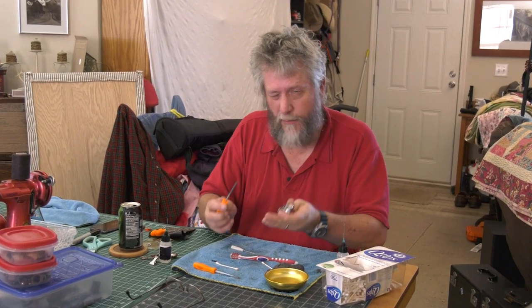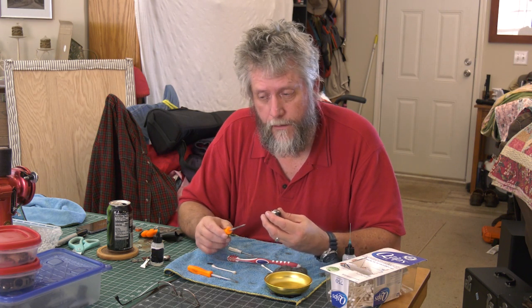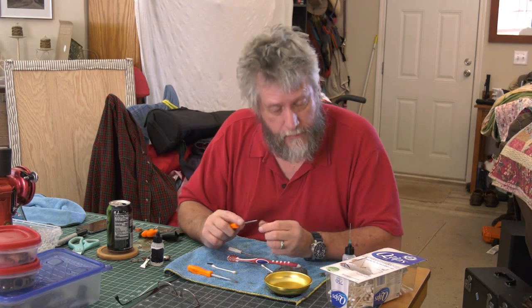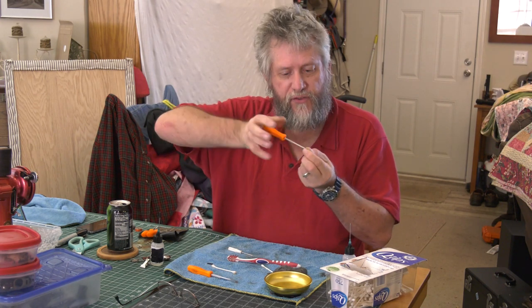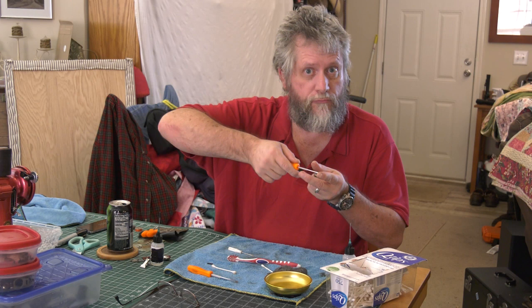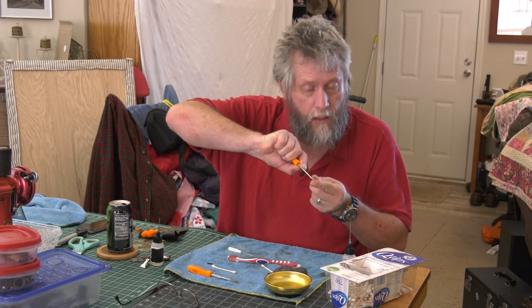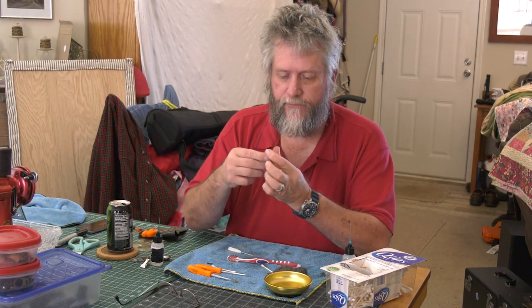Let me get off track just a hair, but it kind of pertains to this since we're talking on these screwdrivers. When you're told that you have a longer screwdriver, you have more power, your grip gives you more power. Yeah, it's true, okay? But the one thing that you have to keep in mind, this tip has to stay in contact with the slot. So if you have all this force going this way, but you don't have enough force pressing it into the screw, then you stand a good chance of rolling that screw too. So you've got to also make sure you have that downward pressure on the screwdriver to keep it pressed in tight to the screw. That was my rant for the minute.